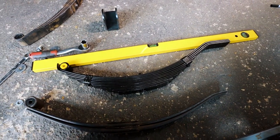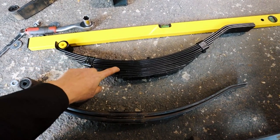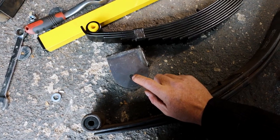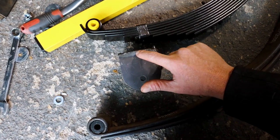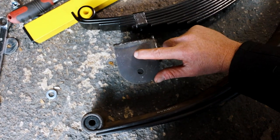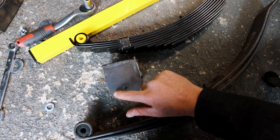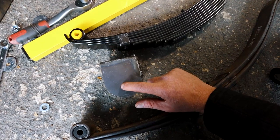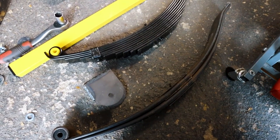So not necessarily ground clearance — you can't change that, it's determined by your wheel and tire. I don't really want to lift it the whole 40 millimeters, so what I'm going to do is just re-drill these units. As long as the bolt can turn in there, and there's more than enough space, I can raise the bolt hole by a good 25 or so millimeters, which will then lower me back down to almost where I was before the spring pack. I'm not even going to cut this off — I'll just use multiple holes. If I ever need to raise the trailer, I can bolt it to the lower hole. It's not going to cost me anything, so I'm just going to drill two new holes here, and that should be fine for housing the new spring packs — and I'll have a lot more suspension travel.